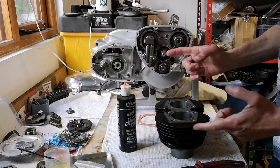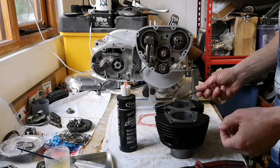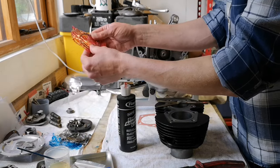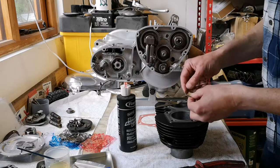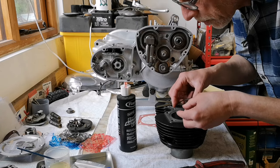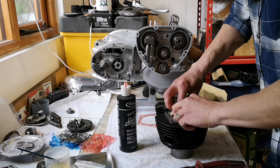Also, while the barrels are out, I want to gap the piston rings. Very good practice, gapping the piston rings. So to do that, you need feeler gauges, and then you need the one that says first. That says first. So, piston ring. One of these says top on it. That says top because they're tapered rings, right? So you get the ring, you put it in the barrel,